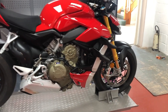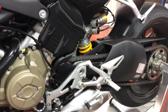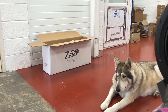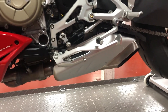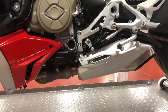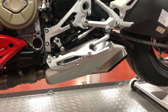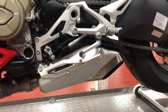So on the build today we're going to be swapping out the OEM exhaust and fitting the Zards. We've gone for the titanium versions — the titanium sleeves. Apparently they're half the weight of OEM. I believe OEM is just over 10 kilos, and the Zards are about five kilos. They also increase brake horsepower by nine bhp apparently. We will be having a dyno on the bike once we've fitted all the parts, with our good friend John Barnes who has a mobile dyno.